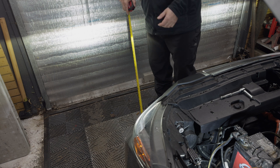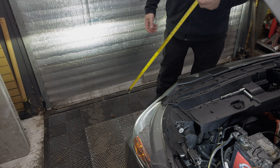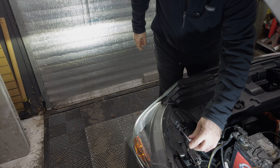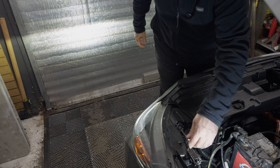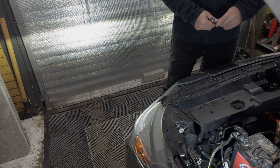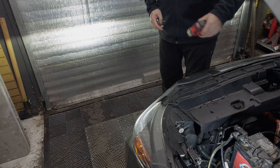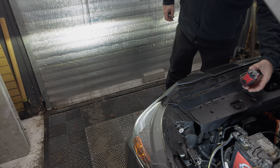When you put the brights on, you can see what it looks like — the brights only come up a little bit higher but are obviously much brighter. You can see how quickly that light comes up when adjusting. We're aiming them just a bit low so that nobody complains about having low beams in their face. You see a lot of LED lights on new cars these days where the lights are aimed up too high and you really are getting blasted on low beams. So: 8mm bolt, up and down, about 30 inches is a good place to start.